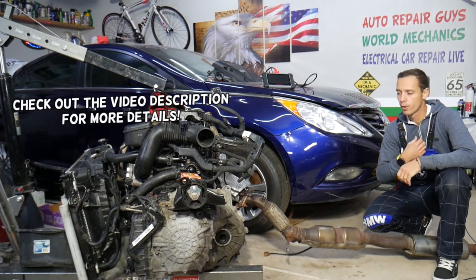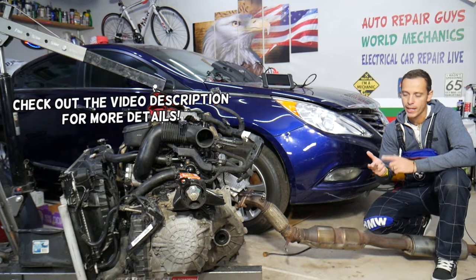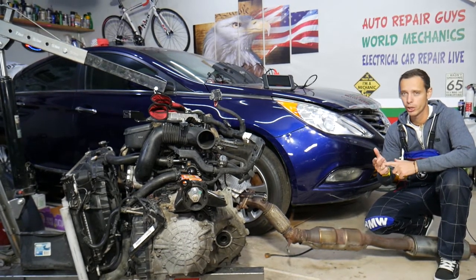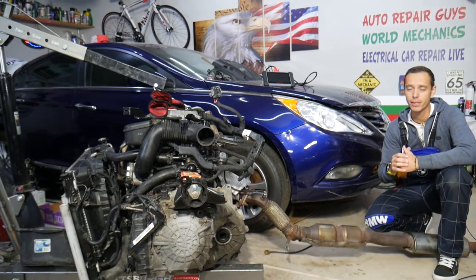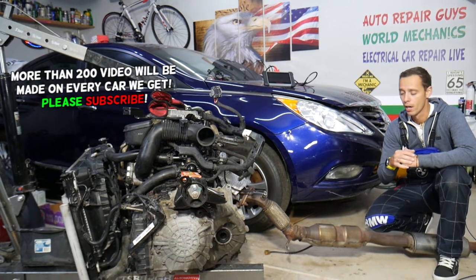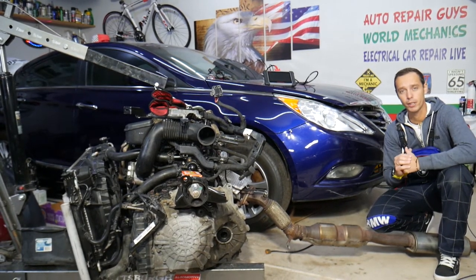Today will be a super helpful video to any of you guys having a Hyundai or Kia, it could be any model, any year, with the check engine light on and code P0420, which indicates a bad catalytic converter. Stay with us, we'll explain what can simply cause that, and how you can fix it in some cases real cheap instead of replacing catalytic converters, because they're expensive. All that will be covered in this video today.